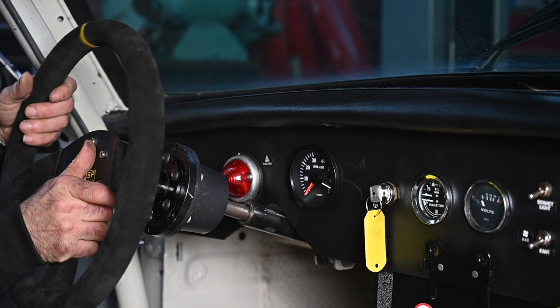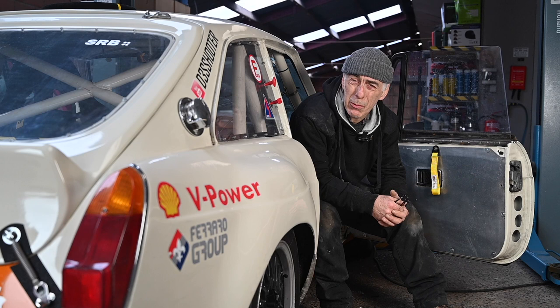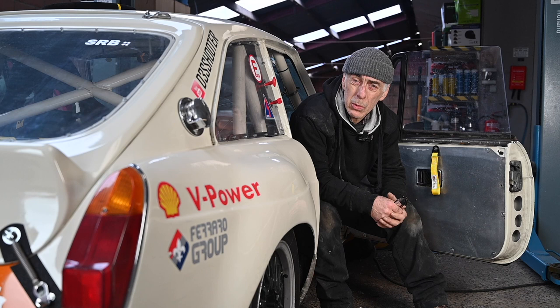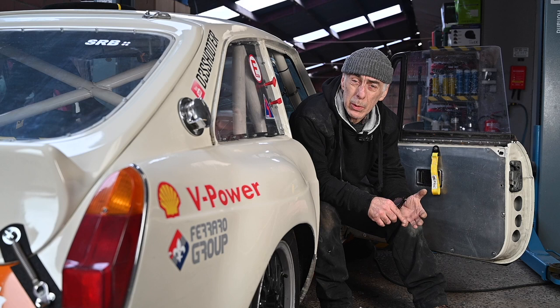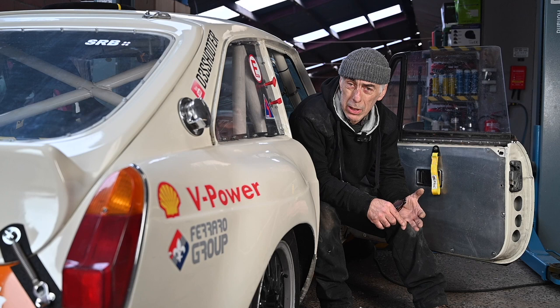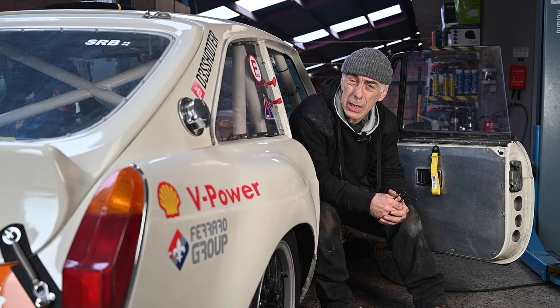We've come to the end of this video. In the next episode we're going to work on the engine bay — it needs a little rearrangement. We'll install an expansion tank on the cooling system, a spill tank for oil and coolant, and the fire suppression system inside the engine bay. We're also going to work on the fuel system, installing a fuel pressure regulator and gauges to make sure the carburetor isn't getting too much fuel pressure from the electric fuel pump. When all that is done we move on to part four — changing all the fluids, brake fluid, and cooling liquids, so the car is finally ready hopefully by the 17th of March to get on the track. Thank you for watching, bye bye.